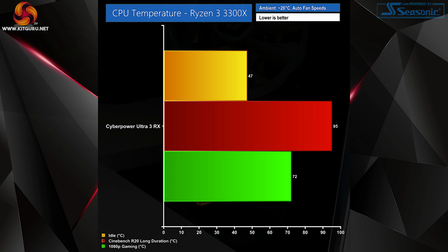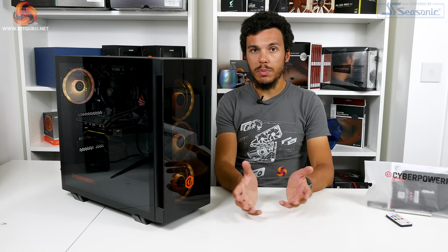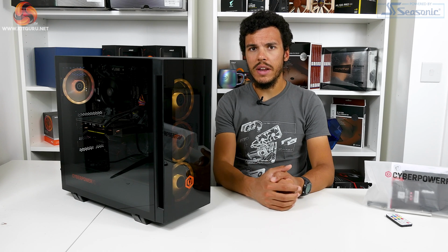And obviously when we're gaming in Red Dead Redemption 2, there's lower overall demand on the CPU, so it was able to comfortably operate around the 70 degrees Celsius level with the Wraith cooler. We'd say that the CPU cooling and temperatures were perfectly fine, and the cooling actually does a pretty reasonable job, especially when tied in with the Precision Boost 2 algorithm that compensates for any higher temperatures.